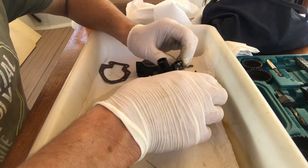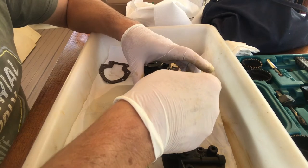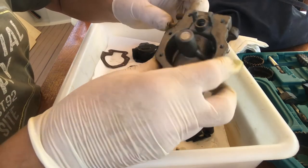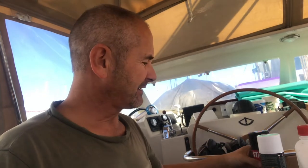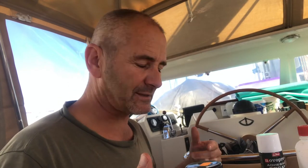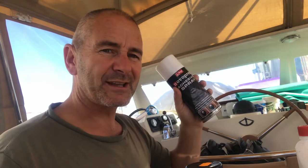Be careful not to damage the throttle bit because it's very delicate plastic. That's the throttle cable, and you can see how it leads to the air in and out with the gasket. It all looks pretty clean so I'll just give it a spray through with some fogging spray. Rule number one when you're cleaning out your carburetor: don't keep your fogging spray next to your adhesive. I picked up the wrong can and sprayed adhesive into the jets, so I spent the last two hours trying to find somebody with an air gun to clean them. I washed through with acetone to clear the adhesive and blew it out with compressed air. So a 20-minute job turned into a two-hour job. Don't spray adhesive into your carburetor.